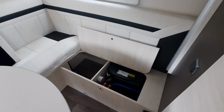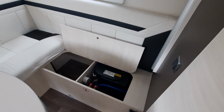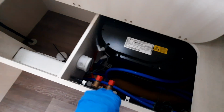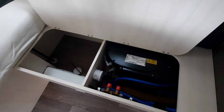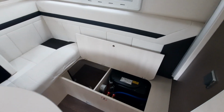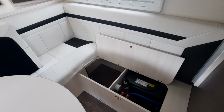Just underneath this area, I've just lifted up the seats, just to show where your boiler is. Now, I was just mentioning before about your grey taps, they're actually red in this vehicle, and these are your isolation valves. Again, just leave them as they are. Now, your boiler looks very complicated, however the only thing that you need to know underneath here is your drain down point. As I say, you've got 3 main drain down points. You've got your wastewater, which is external, along with your fresh water, which we've been over.